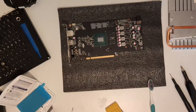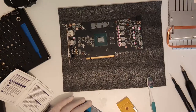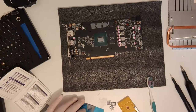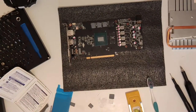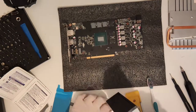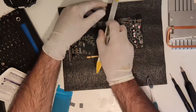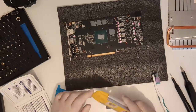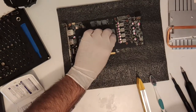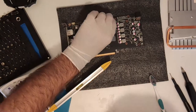And now for the preventive maintenance part of this video: adding some thermal pads to cool down those memory modules during usage. I only have some 3mm Gelid Ultimate pads left over from a previous project — they are not ideal but they will do. They are way too thick and too tough, but with a bit of persuasion and careful squishing using a spirit level I managed to get them down to about 1.3mm thick or so. It will not be perfect, but when the alternative is no contact whatsoever the uneven pressure begins to sound like a pedantic concern. I use the same spirit level to make sure the pads do not stick too much over the GPU die so that the cooler is not held off.